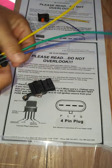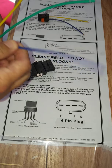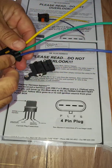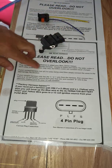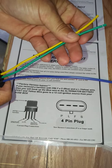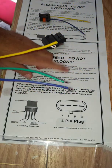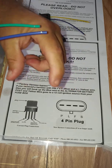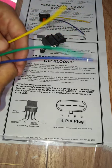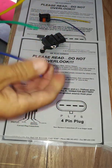On the final set of instructions, you'll notice there may be a remaining wire available — the sense wire. As it says in the instructions, once you connect the L and the F (if necessary or required) together, your S wire is going to go on the alternator's positive post — that's the big copper lug you'll see on any alternator. That is the alternator's positive post. This connection is what typically turns off your battery light.